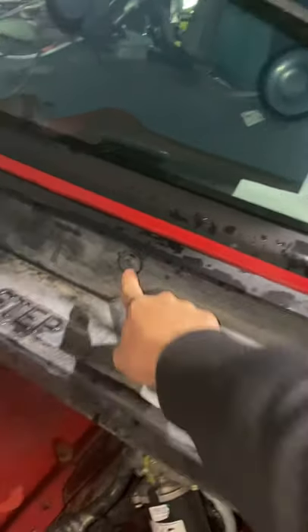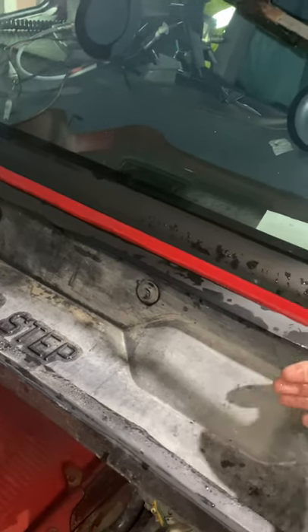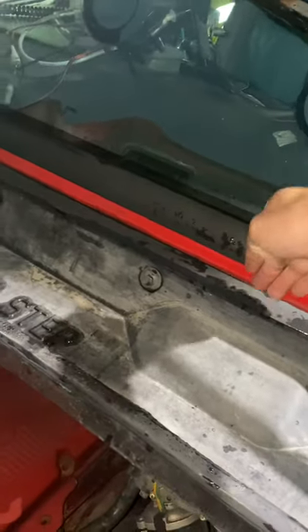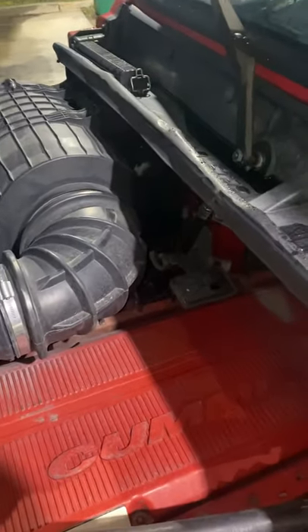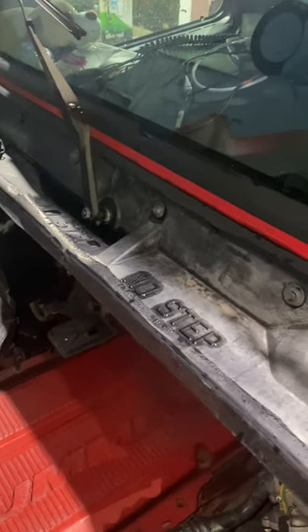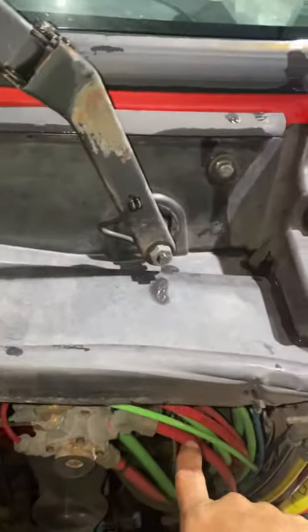Also take note that these splash guards, being plastic, will over time start to bend outwards between the bolts that secure them, and water will find its way inside and get the whole bay wet. In this case this truck is pretty dry, and it's been raining all day — we came through Texas, Mississippi, Louisiana, Alabama, and Georgia. I see no water right here, so that's a good sign, but we do need to take care of that drain.